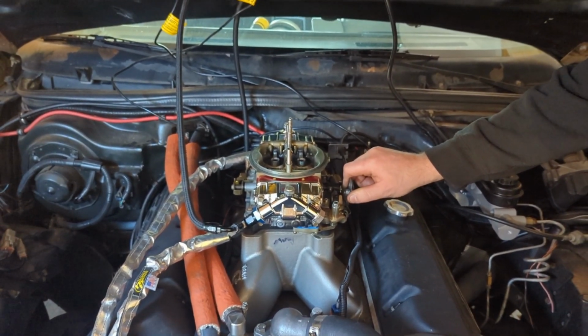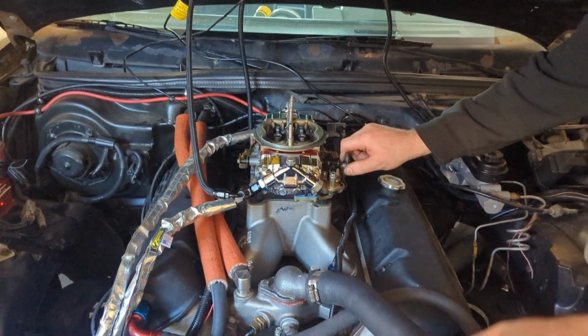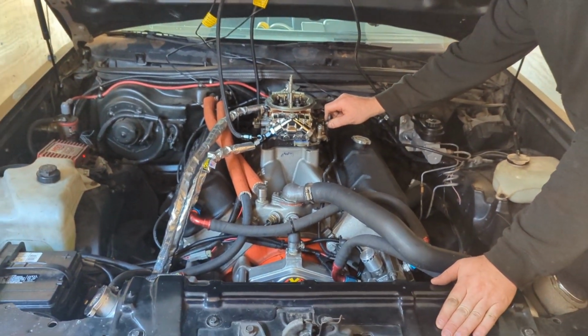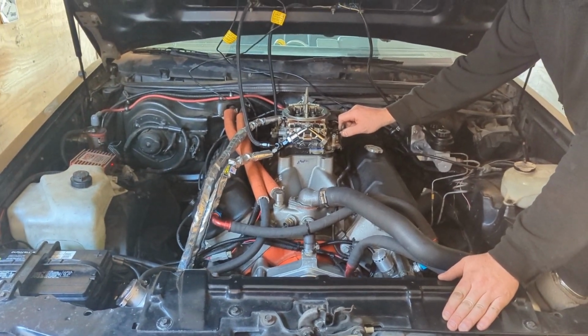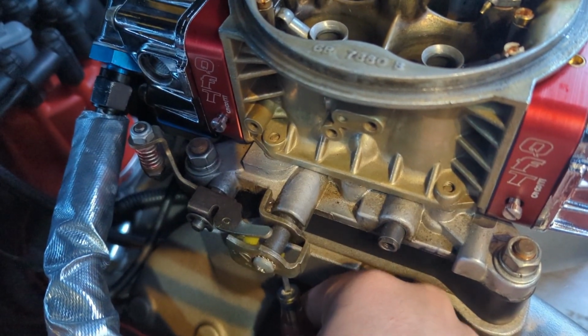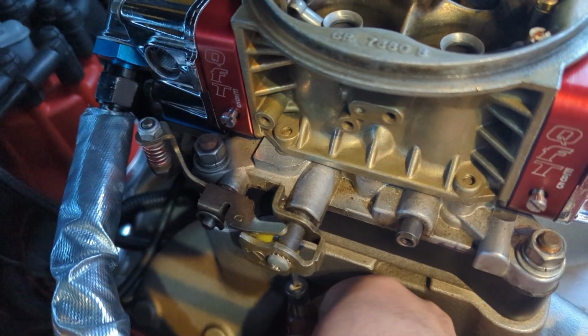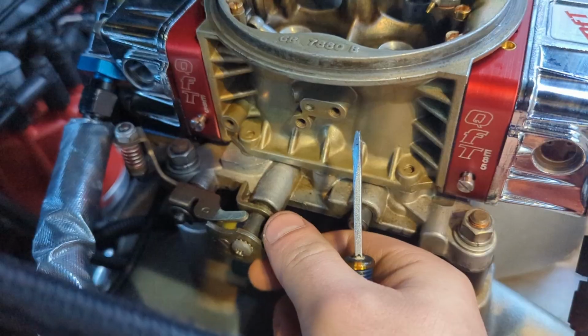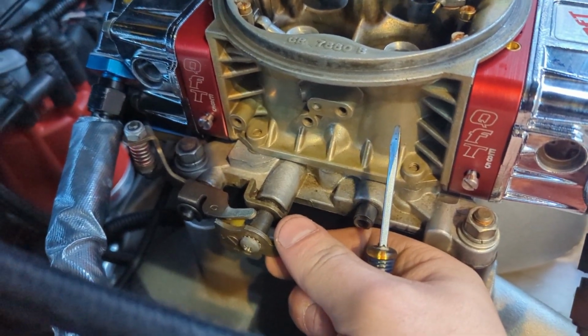It's good to hear this thing run again after a long winter. With all the modifications I've done, I had to retweak some of the adjustments. I do a lot of my idle speed setting on the secondary side of the carb so that I keep the front idle screw almost all the way backed out. This keeps the engine near perfect, just cruising around and at highway speeds.